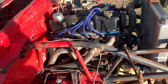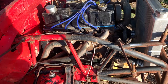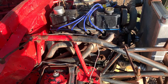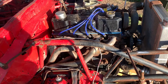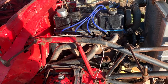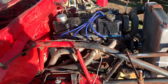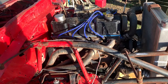A can of starter fluid later and we got it running, but it was only running on the starter fluid. Even after starting it a few times, the carburetor was still not getting any fuel. There's a fuel pressure gauge down below that was actually reading at 5 to 6 psi, so I know fuel was getting to the gauge — from the tank, to the gauge, to the carburetor — which is a pretty clear indication that the needle and seat in the carburetor are stuck.